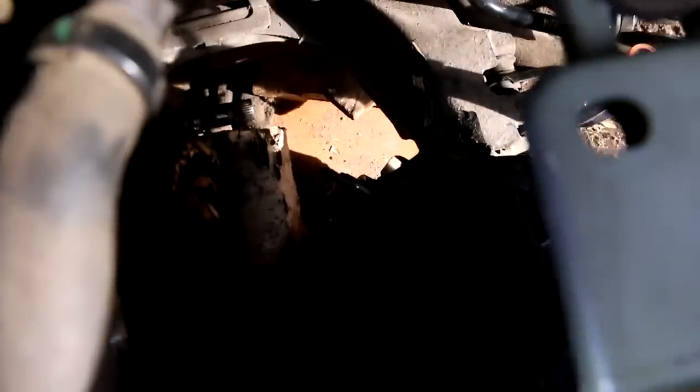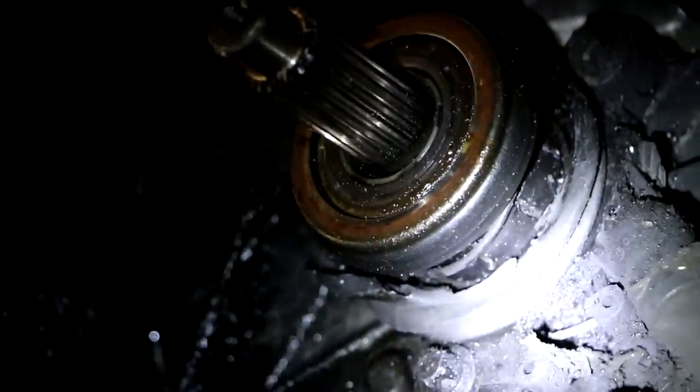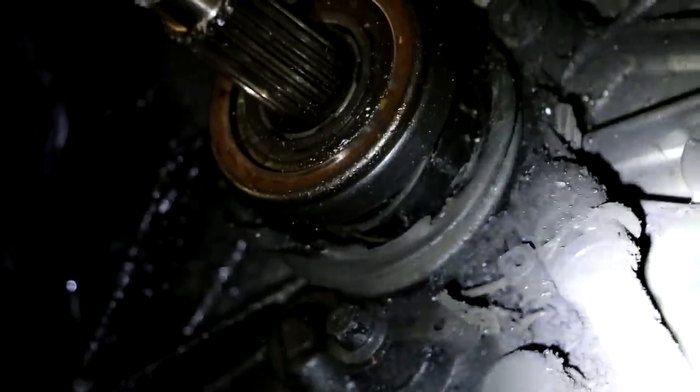So guys, finally I got out, not out, but to have this, well, as you can see, I've removed this side of the gearbox and it's now on the ground, easy to access. So to get there, I took some really big effort, it wasn't easy at all, but here you can see what has happened. Looks like this rubber boot around it has smashed and is destroyed, so I had to replace this one. Plus a little bit of scratch outside of the place where it goes in the shaft. But anyway, it's not a problem.